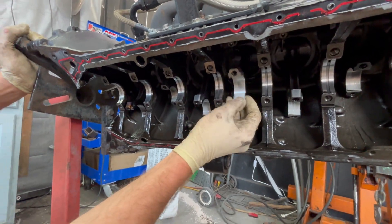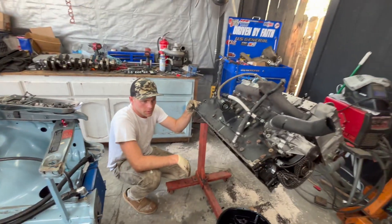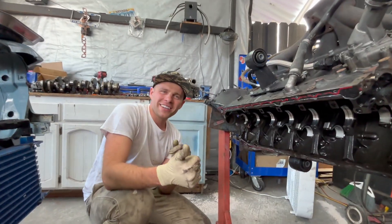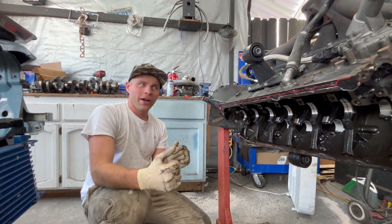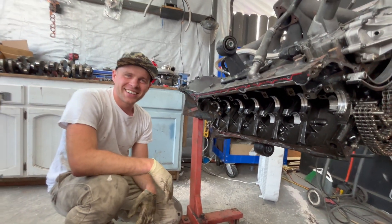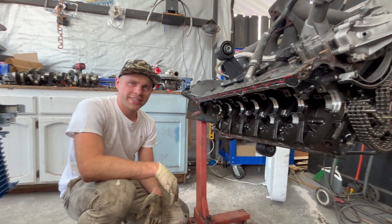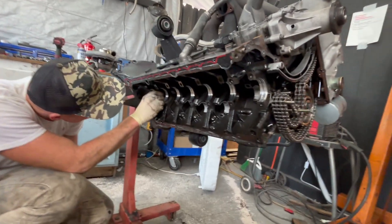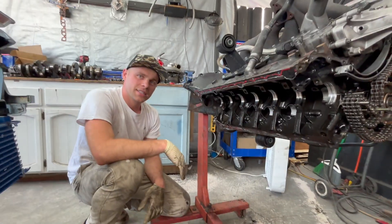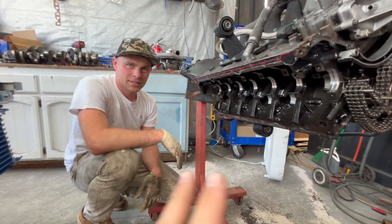I think this is my fault because when I was bolting down the connecting rods, Dennis caught it in the video saying he thinks I did way too much torque. I don't think you need to put in that much effort tightening the rods. I read online somewhere that it said 45 newton meters and then 90 degrees, and I was like that sounds way too much. So I texted Diesel Pump UK, the person that makes these performance rods, and he said they're way over tightened. I tested the torque — it was 115 newton meters. They're supposed to be 75 newton meters.